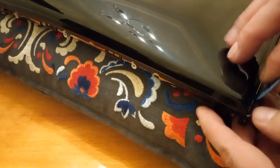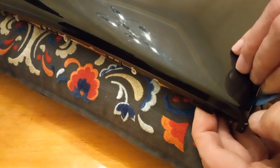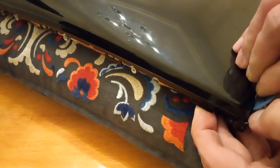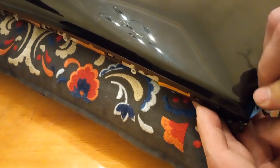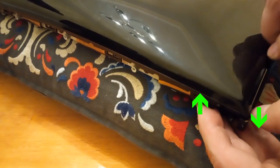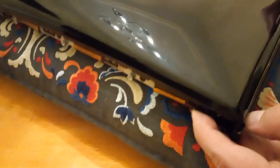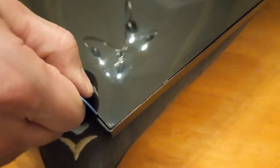We'll start in this corner, and this monitor can be difficult because the snaps are tight. So you'll put something in here between the back and side panels — I use guitar picks personally. Once the back panel separates from the side, apply some downward pressure on the side to keep them from re-snapping. You may need to pry a little bit, but not too much.